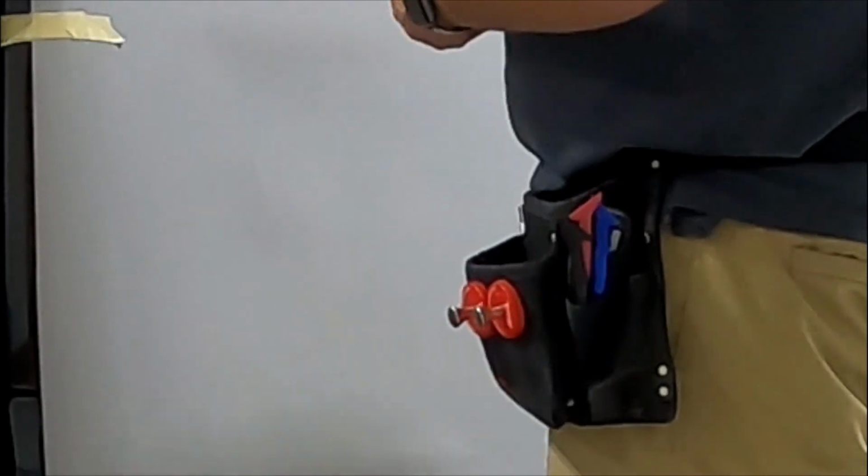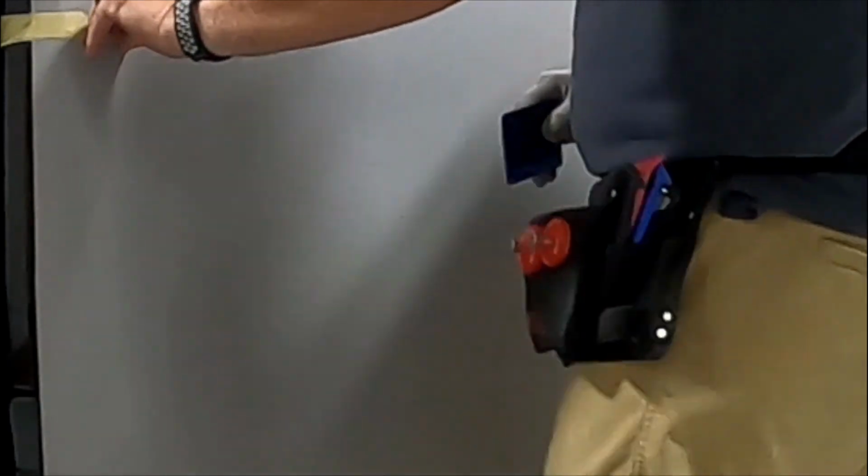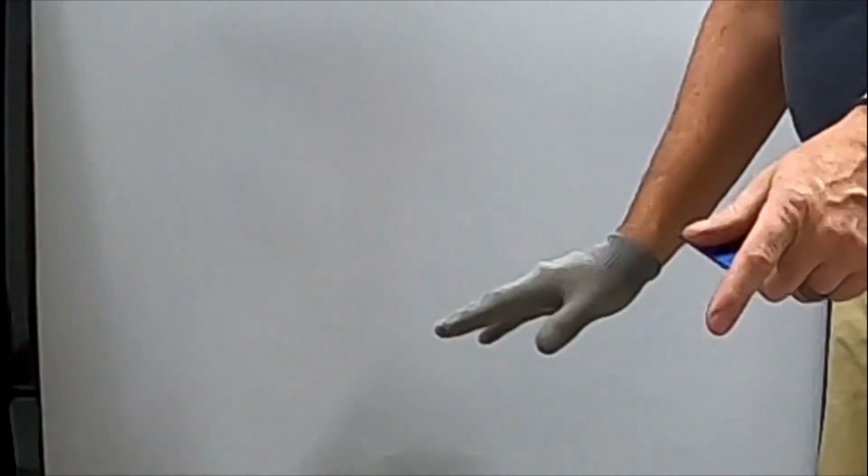Nice pivot, take my squeegee. There's a little body line right here that's good. You can see that's the backing paper right there. Now I've got a line set, so I pull the masking tape off. I no longer need that; the vinyl holds itself at this point. Then I'm going to work up. I'm not going to worry about the bottom. There's backing on it, so I don't have to worry about dirt getting under it. It's fine how it is while I work this top.